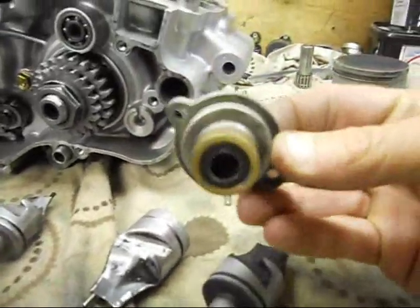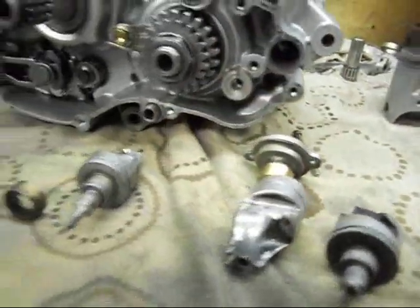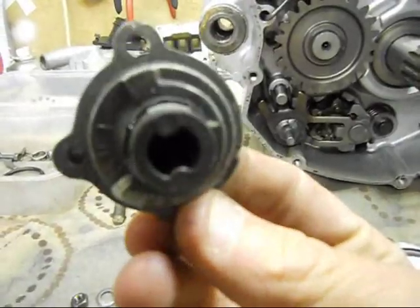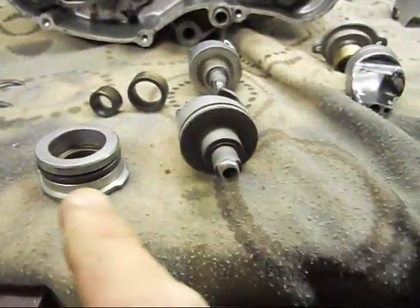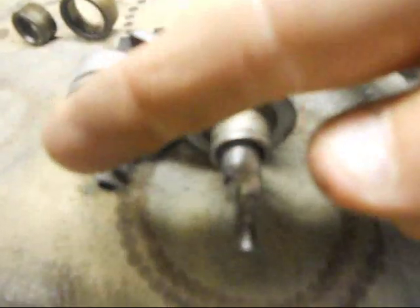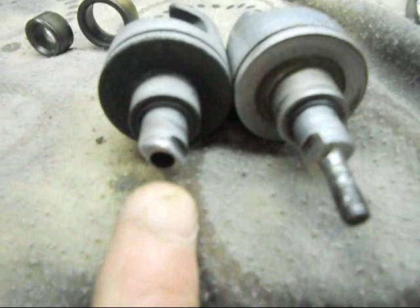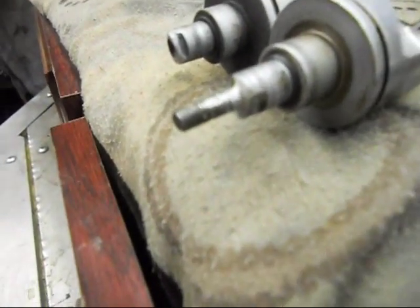The difference is, apart from the holder on the back which has no lugs — it's just literally a bush that sits in the round end — the other one is completely different. This bit here, which goes on this end and holds this end of the power valve, had no rubbers or centers in it. You can see the ends are completely different — these dimensions here are the same but the ends are different: one's got a screw that goes inside and the other's got an external bolt thread.